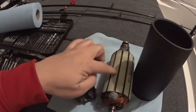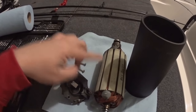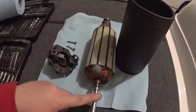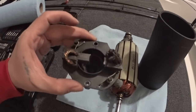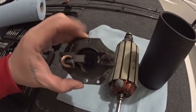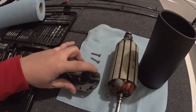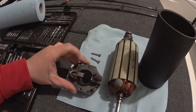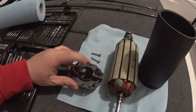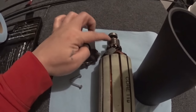I thought it was just the armature that was going to need to be replaced, but after taking it all apart and upon inspection, this was obviously slightly warped. So I had this whole assembly — just the armature — but like I was showing you earlier, I ordered a back plate as well. This whole thing has to be replaced because it's plastic and it's all melted where the brushes are. These things should be like this — see, this one's not. So I had to order a new brush assembly and new springs; the spring loads it and rides on top of here.